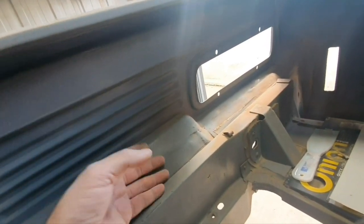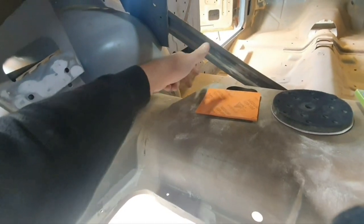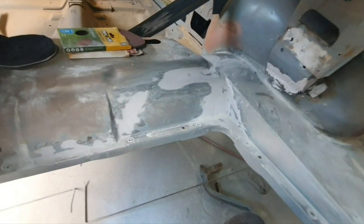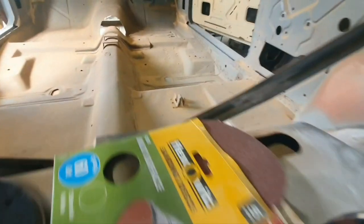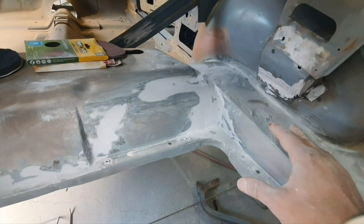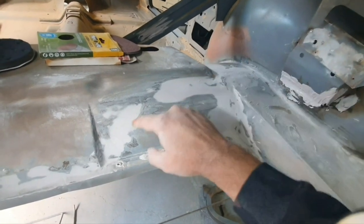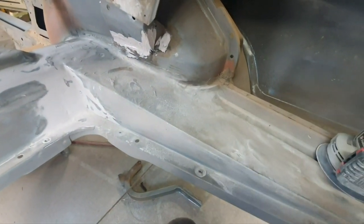I think this is meant to be like the colour of the car, but I'm thinking I might just leave this black, and then from this point forward right through to the start of the floor panel — I've shown you this before — have that burnt orange, all up in here burnt orange. This car's got a chassis — the whole right-hand chassis is out of a sedan, so you can see a bit of a support there for the seat, but the other side hasn't got it, so that's got to come off. Rather than just taking the chassis out separately, I've just cut a section out of the floor — which was rusted anyway — put the section completely in. There's a joint across here, all this is rear spares — there's a lot of welding.